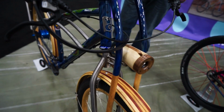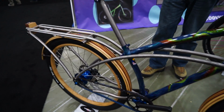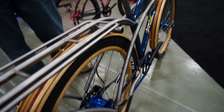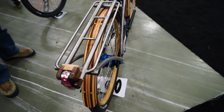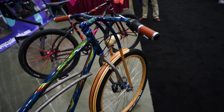We also use the old school cruiser style design, but it's fairly updated. The back uses a Paragon yoke, which allows us to run a 650B with a belt drive without having any chain stay interference issues. But also, the bike is designed to go 26 plus if he chooses to go with a wider tire, and it won't change significantly the bottom bracket or the handling characteristics.